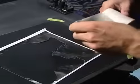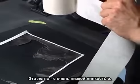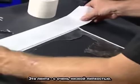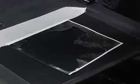Now I have some transfer tape here. There's lots of different brands out there. Any tape can work right now. This is a very low tack tape. It doesn't leave any adhesion behind. And I'm just going to skirt this on here. This is going to look after two things. It's going to keep our placement very well on our panel, and it's also going to cover up our overspray.